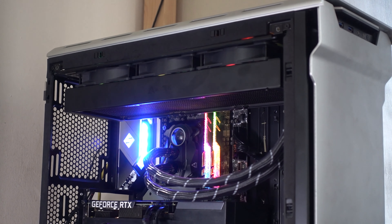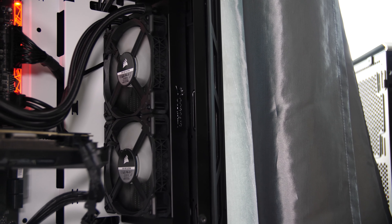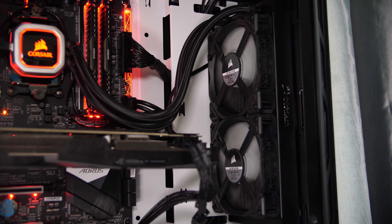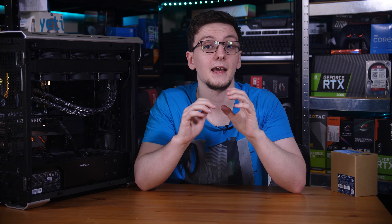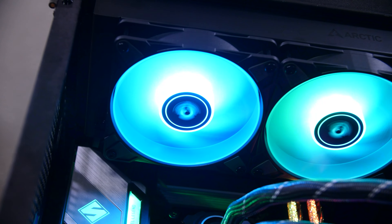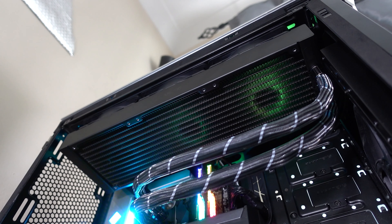My advice would be to mount whatever is easiest for you to get set up and to maintain. At the front of a case I would go with a pull configuration, since it'll be easier to clean the dust off from the front of the radiator instead of having to remove the fans — and installation will be easier since you won't have to fish the long screws through the case, then through the fans, then to the radiator. Trust me, the holes won't be aligned and you will end up screwing through the fins or some of the tubing, and that's just a very bad time. If you're mounting it at the top, generally speaking you want a push configuration, because it's easier to install and you get to see the shiny LEDs more directly, shining light across your case rather than having to look directly up through the bottom of the radiator.